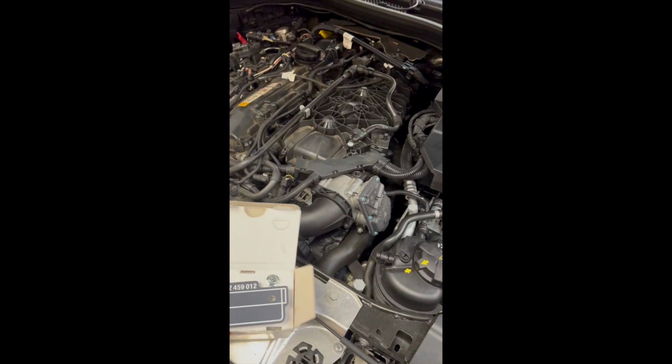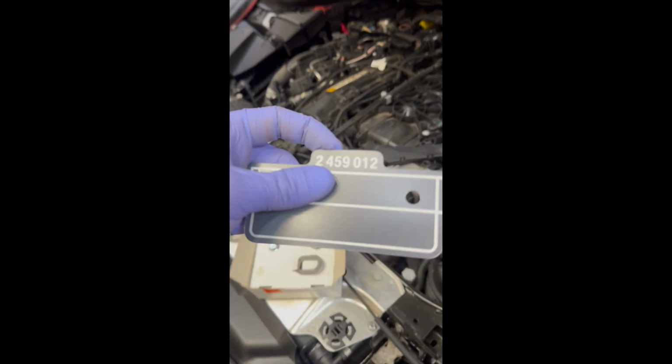There's already an included engine hoist in the front, and in the rear you're actually supposed to put a hook into a loop on the rear of the cylinder head. I was reading the service manual incorrectly. You do not need to purchase this engine hook. Later in the video, you'll see where you're supposed to hook in the front with the included engine hoist hook, and in the rear, you will see the circular cutout where you're supposed to put a hook through there.